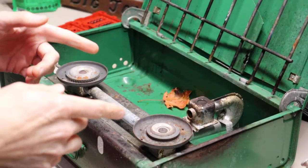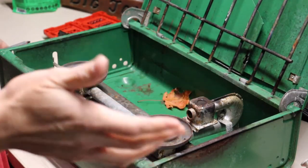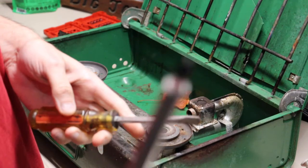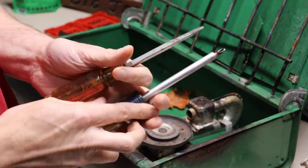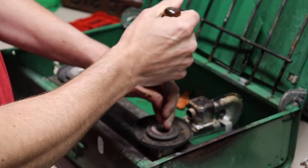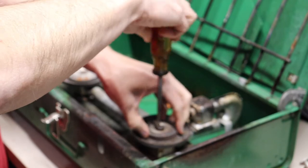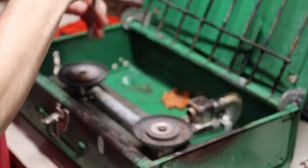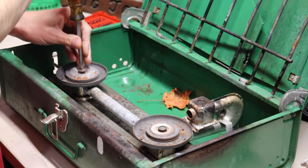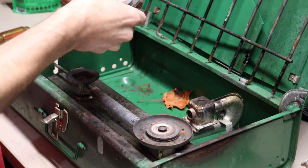The first thing I'm going to do is take the burners apart on the inside. From what I'm looking at, the most you're going to need for any disassembly on the burner unit is a number two Phillips head and a plain old flathead. You'll use the flathead on the actual burner part. This has been apart before, so that's why it's coming apart fairly easy - it's not seized up or anything. I highly recommend doing this every once in a while with your stoves.